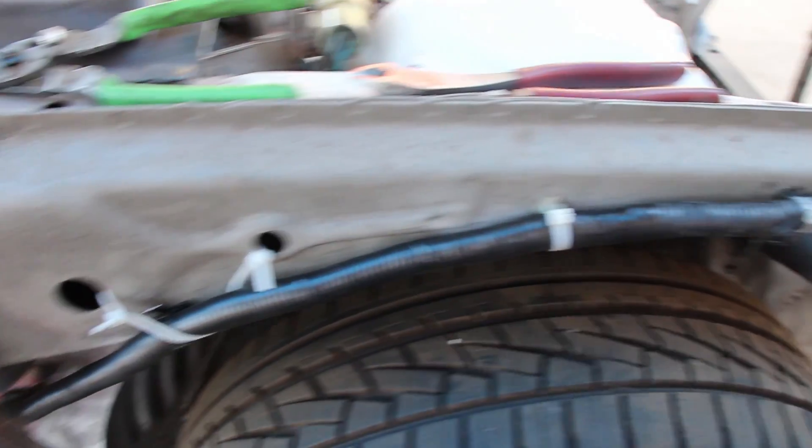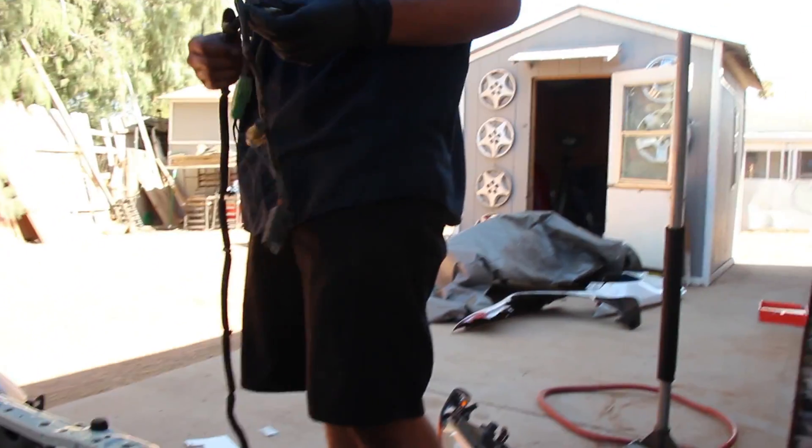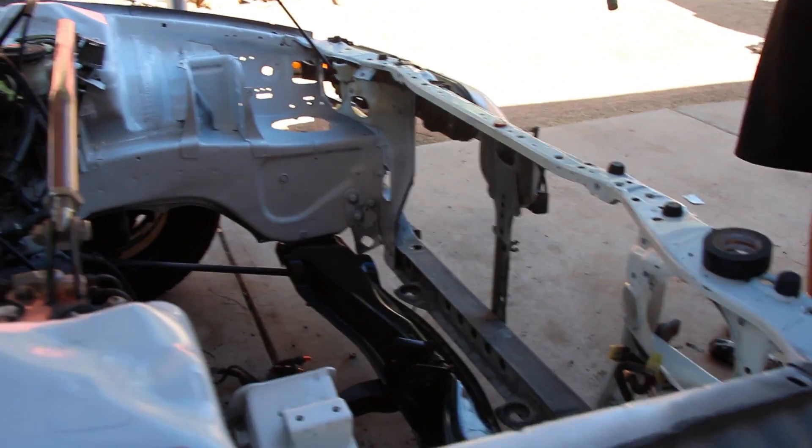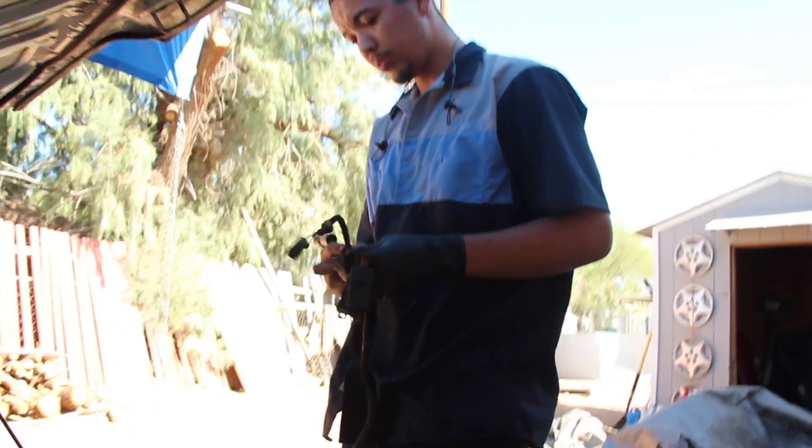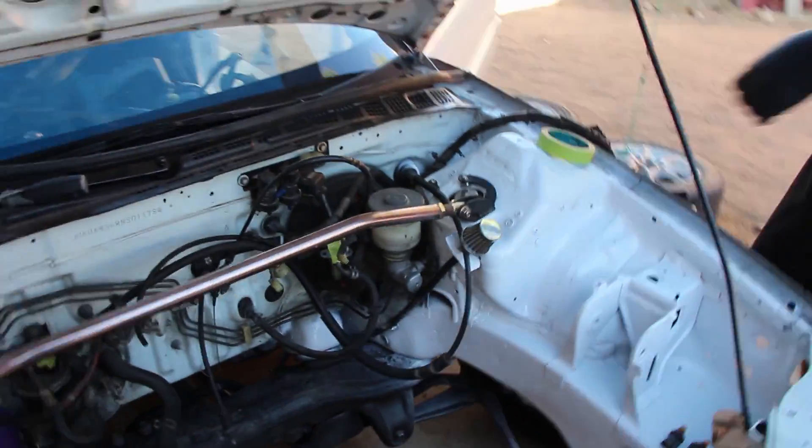Here is the passenger side, all nice and tidy. That's just for the headlight and fogs which are going to be popping right there. I had to readjust my hose to compensate for my strut bar for my power steering line. Just have that one line left to do which is my radiator fan. Then got to drill a hole on the other side and run that side, and then we can pretty much be done — throw the dash in, call it a day. This side is done, all tucked up and nice. I unplugged the AC crap because I won't be needing it, and I'm going to be running my radiator fan to a switch like I was before, just for simplicity's sake.